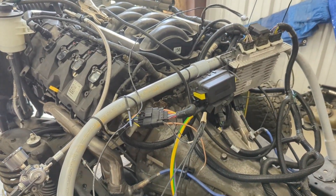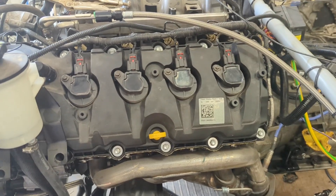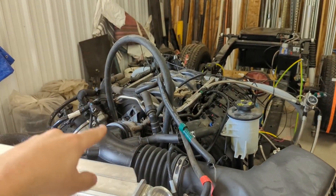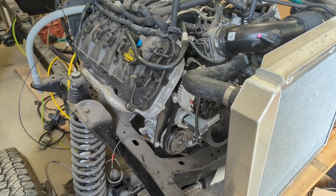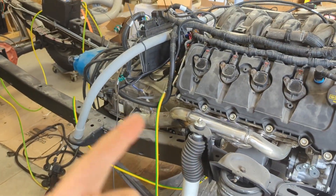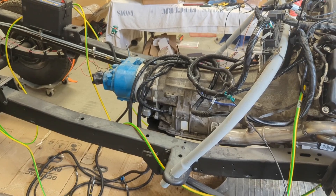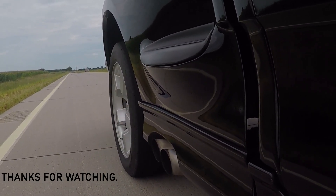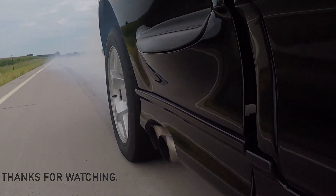We wanted to check and make sure that it had oil pressure and didn't have a massive rod knock or things like that which you could potentially have with a salvage engine. We did that, and now it's on to the next thing. We actually warmed it up so much that it took water — the heater hose got warm, and both lines on the radiator were warm as well. Hope that gets your Coyote swap going if you have a Gen 1 with the Power By The Hour 6R80 kit. It's a specific combo, but maybe it'll help you. Thanks for watching.